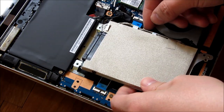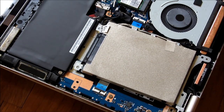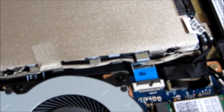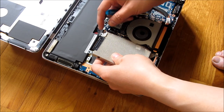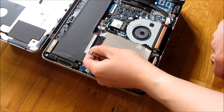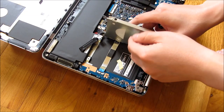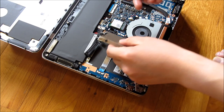You have to be very careful because there are wires here. So to the side of the hard drive, you'll see there are wires along the casing — that's something you want to be very careful of. I'm just sliding the drive out — it's half out. Now the SATA cable is disconnected — you'll see that's the hard drive tray.